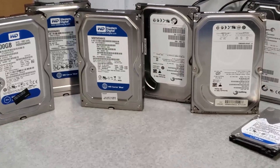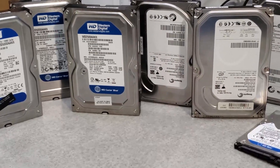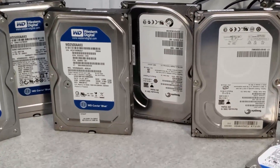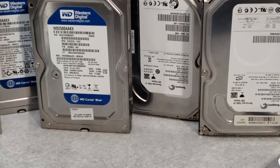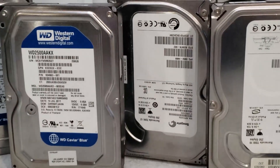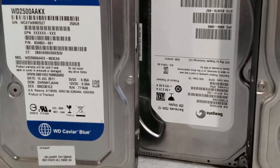Hard drives is where the fun part comes in. You're going to need three hard drives that are at least 250 gig, because those are going to be your boot drives for each of these systems. Eventually down the line, if you upgrade, we recommend upgrading to SSDs, but because normal hard drives are easy to get a hold of, we just went with 250 gig hard drives for the boot process. Then the other hard drives you're going to need are at least two 500 gig hard drives — they both need to be the same size because these are going to go into a RAID on your NAS box. And then you're going to need another hard drive; we recommend a terabyte hard drive, which is going to be your storage pool on your Proxmox server.